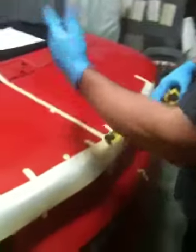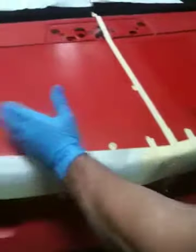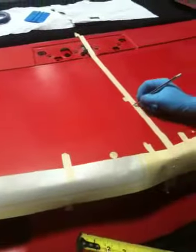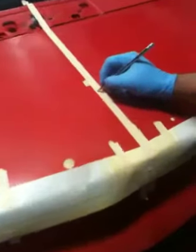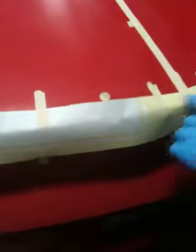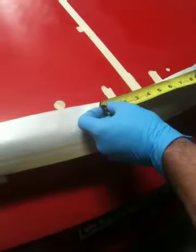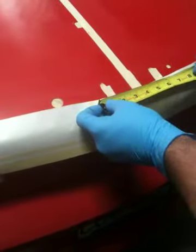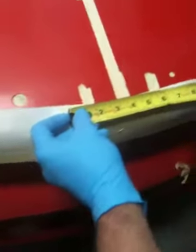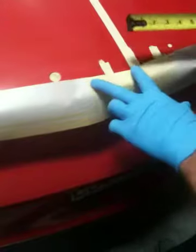In the rear, just like the front, you have to find center. We'll be working off of the left-hand side. Center is located on the left-hand side of the tape. Using the stencils as a reference, they are exactly the center stripe that will be painted — the inboard edge. The edge is 6 inches wide, so you use 3 inches on center to find your edges.